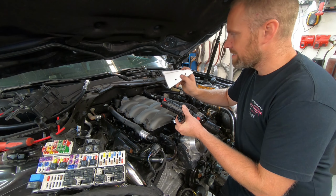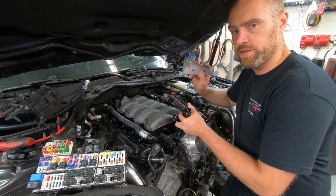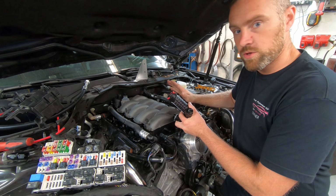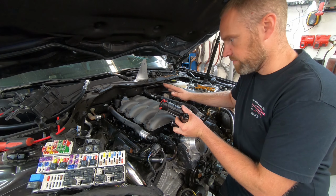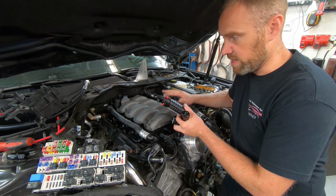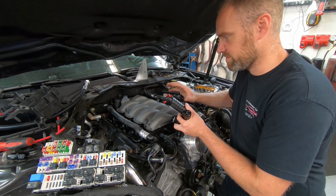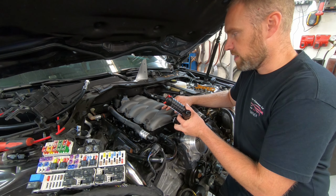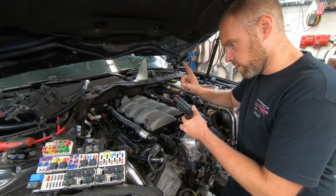Why don't I really care? I think I found a better solution. So, this kit comes with 2 regulators. I am only going to use one. The tuner, he says he will tune it for using a single regulator, and that simplifies everything tenfold. Makes less lines, less trouble inside the engine bay, which is exactly what we need in a tight engine bay like this, is less confusion and less stuff. Because stuff in this kind of scenario is already abundant. We don't need more of it. So we're reducing that by running one regulator.